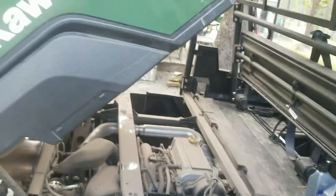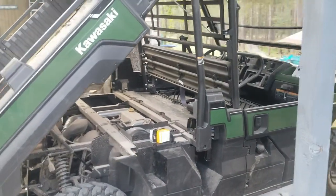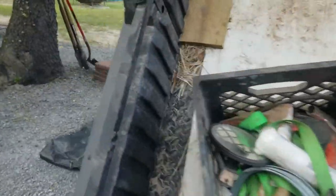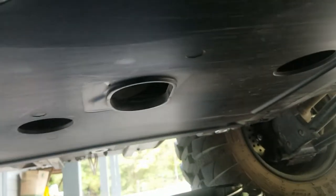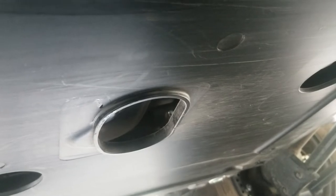You're going to need to raise your bed to get to the filter on this model. I'm not sure about the two-seater FX-T — I think there's an access panel on that one. You'll need a 14-millimeter socket for the drain plug. What you're looking for is an oval-shaped hole under there with a lip on it — all the other holes are round. It's the only oval hole and the only one with a 14-millimeter nut, so that's the one you go to.